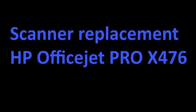Okay guys, today we're going to replace a scanner on an Officejet Pro X476. I'm going to start this repair simply by removing the power and other peripheral cables. We're going to pull off this paper outfeed tray and just set that aside. I'm going to get the unit into a slightly better position. Unplug that USB and phone cable for the fax.